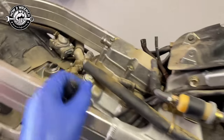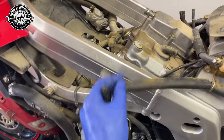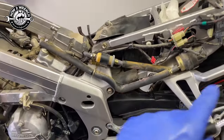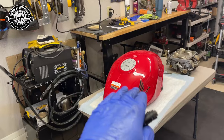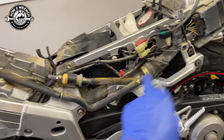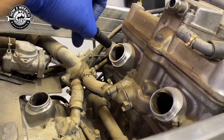This is all just at the point of evidence. I use the pump to pump the tank out, so this being wet wouldn't help me right now. Let's say the night before I set it down dry, and the next day I come back and it's wet — that would tell you it's leaking. If this leaks, the weight of the fuel tank keeps pushing with gravity, it'll go through the pump that's not holding, and it'll push past the carburetors, overpowering the float needle valves and getting into the engine.